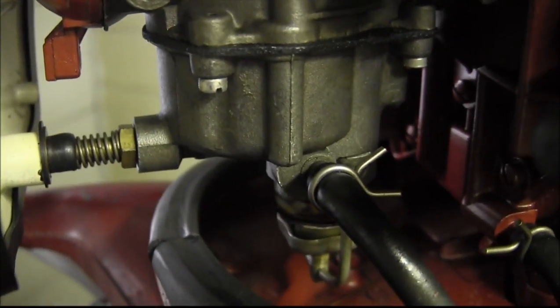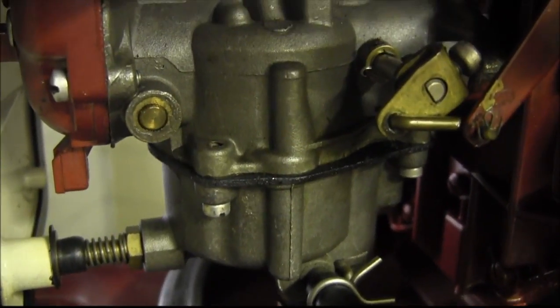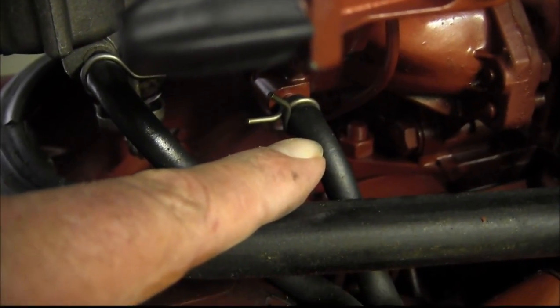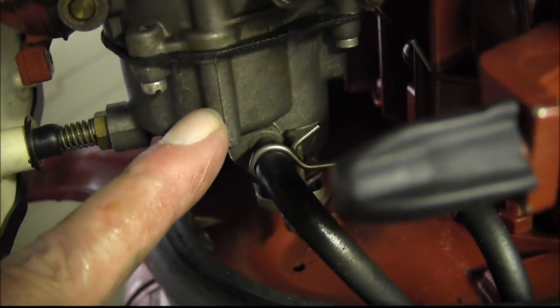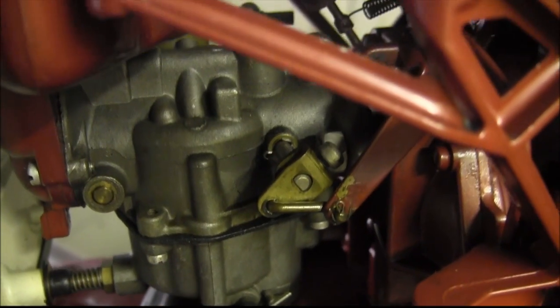I know you can see that. That line would fill the bowl. The air, in turn, would come out of the crankcase pulse, which is this hose right here. That hose put a pulse back to the gas tank, which pressurized the system, and it was a continuous pressure and feed to the float in the carburetor that you see there. Sweet little machine. Works really, really good.